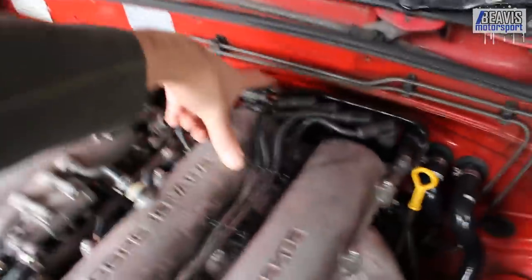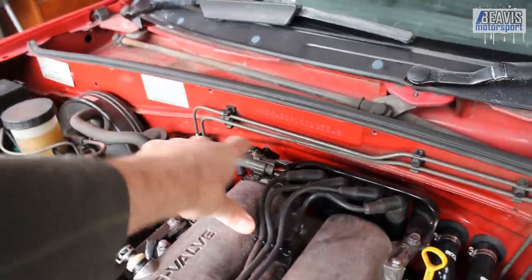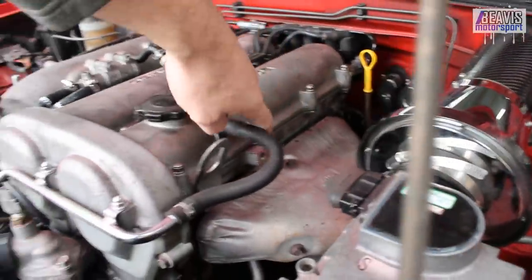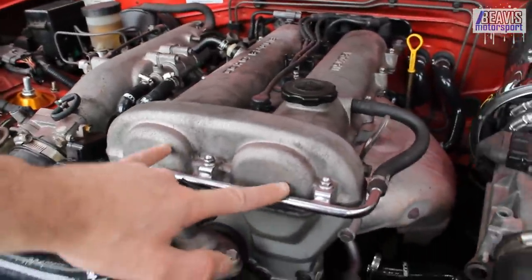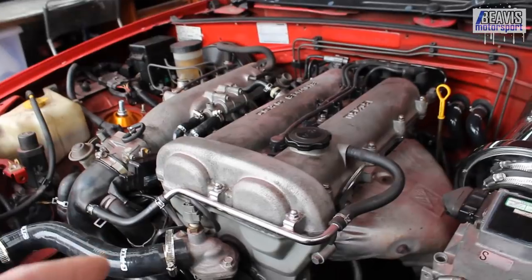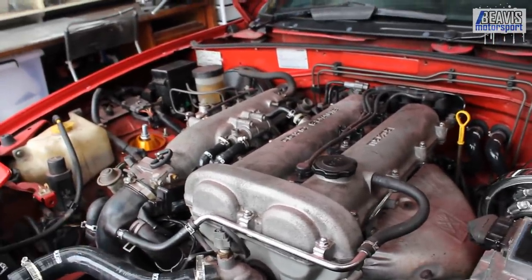Around oil, keep an eye out for leaks. They commonly leak from the CAS — the crank angle sensor — which has an O-ring that often fails. You've also got your valve cover gasket, the front and rear main crank seals, and the two cam seals which are behind the timing cover. These are all reasonably common oil leak locations. They're not all that hard to replace, although they can be fiddly and a bit disconcerting for a first-timer.